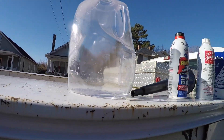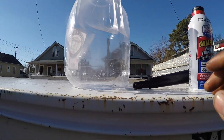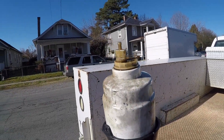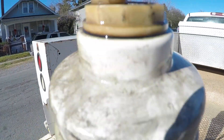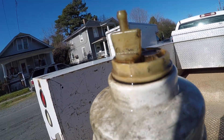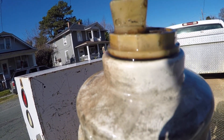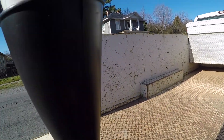I'm saving that fuel for my next video, which is a full GM top-end cleaner. I've just flipped the fuel filter upside down and let it drain. There really wasn't that much fuel in there, but I just want to let it drain so we're not getting fuel all over the place. One thing you'll have to do is transfer this little plastic drain piece to the new filter along with the gaskets.